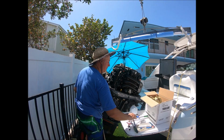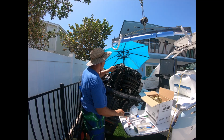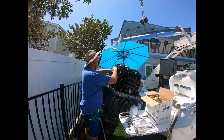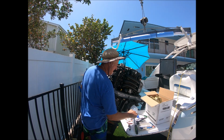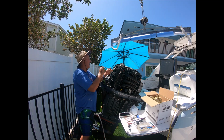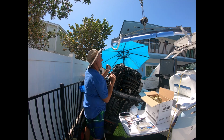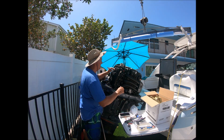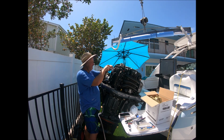And as simple as a 10mm. Take this screw off. And disconnect your electrical. Pop this out. You want a 5/8 long socket. Got some curvature, some power to it. Seems like right about 20 foot-pounds. Maybe 30. Just enough to crush that rib.